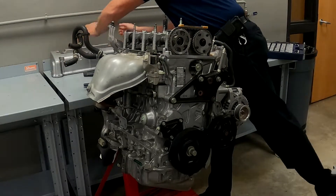With our reluctor wheel off we can take the timing chain off the engine. With tension released we take the bolts loose and get our guide off — this guide came off the intake side. You always want to pull these off and look for wear on the inside edge of the plastic, because it is plastic and it does wear with metal rubbing against it. We also have a guide on the top side of the engine — pull those two bolts loose and take that guide off. Check for wear; this one is pretty good with no marks. Now we can lift the chain off — there's the timing chain off the engine.